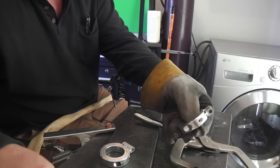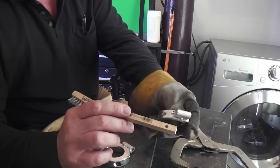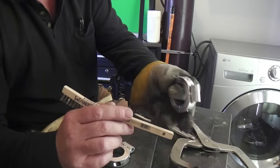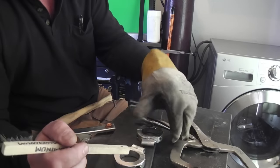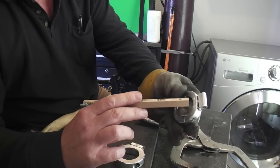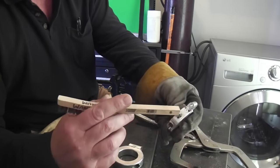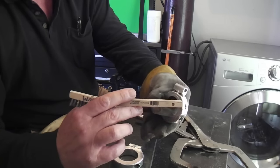I've tacked these babies up. You can see that whatever the alloy is of the collar and this tab barrel part here, they're weldable — they tack up pretty good. I'm going to let it cool carefully between each bit; it's still warm just from these tacks. This is a small part, so I recommend that you keep the lower portion of the collar bolted up to the other half, because if I put too much heat in this, this collar is going to want to shrink or distort. If you have the other side mated to it, they'll shrink or distort together. You don't want those thread holes to lose their alignment — you want them to stay aligned. Whatever happens, you want them to do it together.